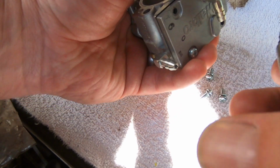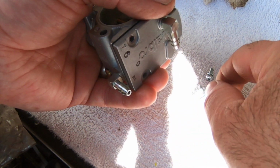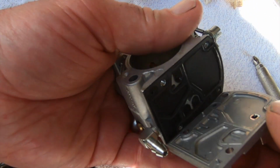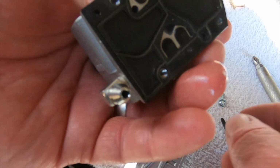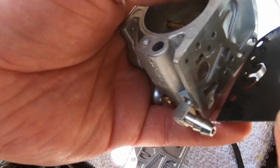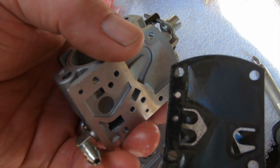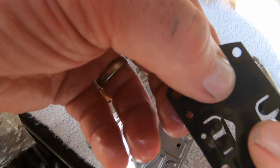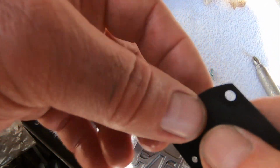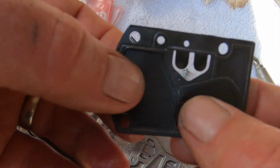Anyways. Get this thing apart, see what we got. There's usually a little bit of residue that sits in there. See? Yeah, it's all of my finger there. Very little, but enough to, if it were to clog, yeah, see, there it all is. If that were to go stale, it's ethanol free, it smells wonderful. If that were to go stale, you're going to know it. It's going to clog stuff up. So, this thing's junk. It really doesn't feel that bad to me. Kind of in the shade here. Hopefully that works out better for you guys.